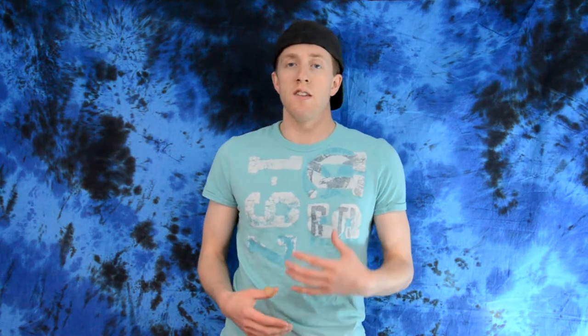Once you've got your clean slate, the next thing you want to do is build your baseboard. A baseboard is basically the piece of wood that you're going to mount everything on — like a foundation. Since I'm mounting my amps in the spare tire well, my baseboard is actually above where the amps are going to sit. I made a nice template shape around the spare tire wheel well and basically mounted that piece to the floorboards of the vehicle.